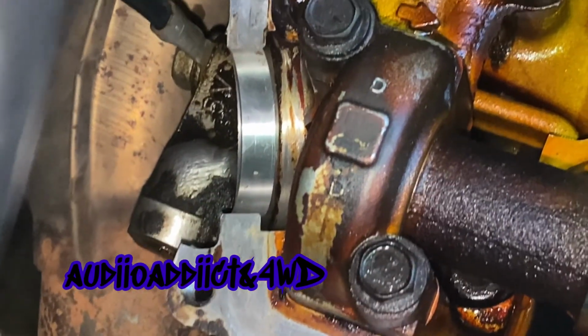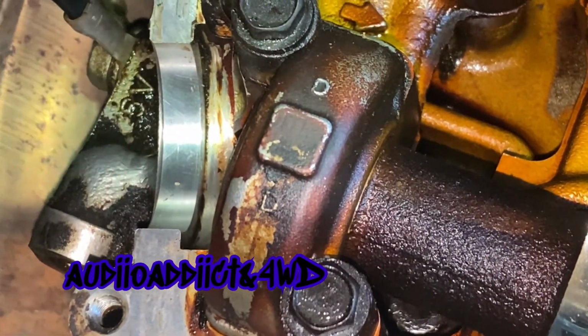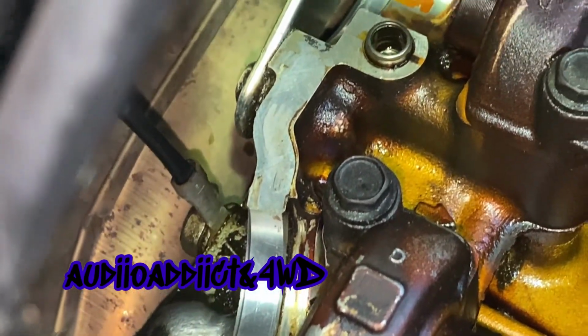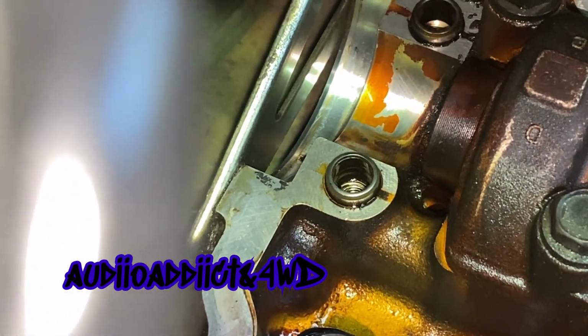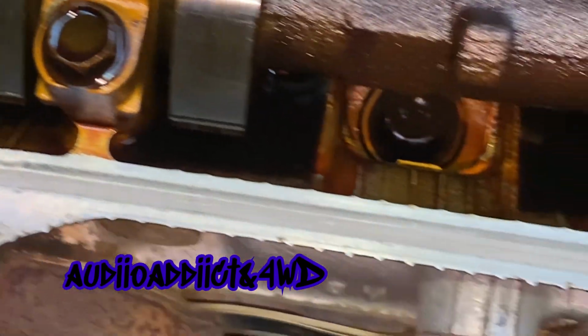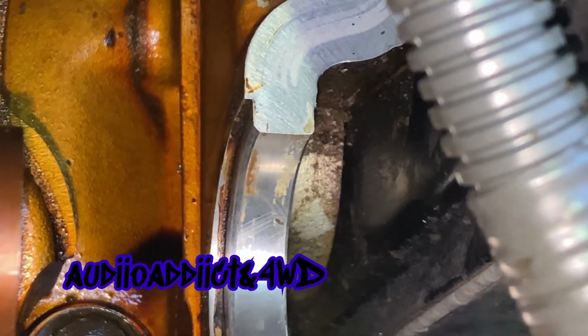I got it pretty much clean here. You really have to look right there. You see where the shine is next to it inside. You need to clean that because there are going to be residues of RTV or whatever that kind of glue is called. Same thing here. You need to clean all the grease, and there should be RTV right there in the corners, those sharp edges. You need to make sure those are very clean. And of course, all around here, I cleaned that with acetone. Same thing here where the moon goes.